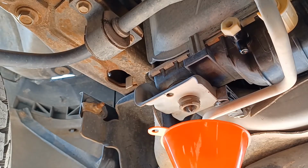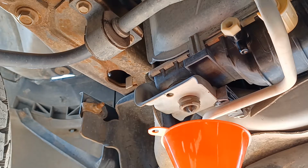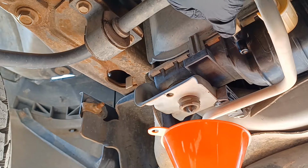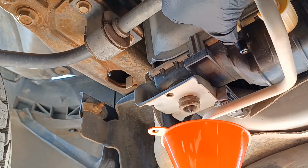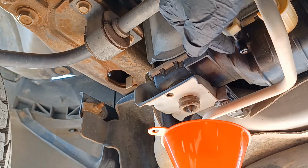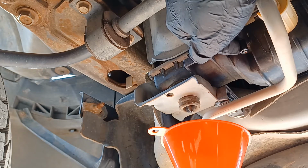Okay, so driver's side, underneath the truck near the front bumper, you're going to find this drain bolt here, which is a 3/4 inch. You can use a 3/4 inch closed end wrench. Fits perfectly. You're going to undo it about 3/4 of the way, and you'll see a nice steady stream drop out of this little outlet.